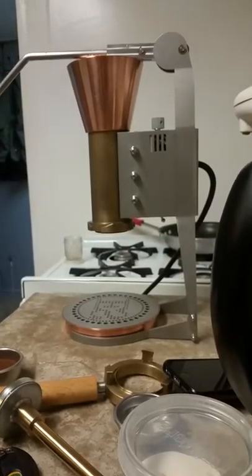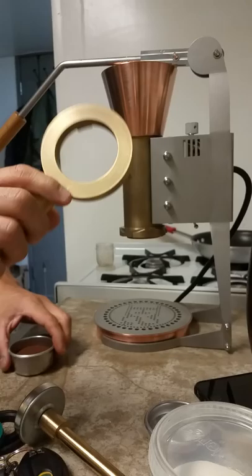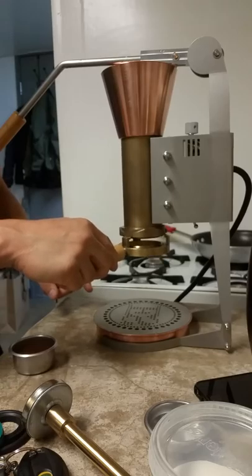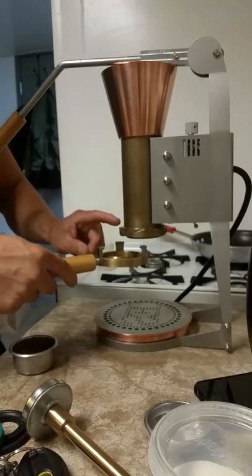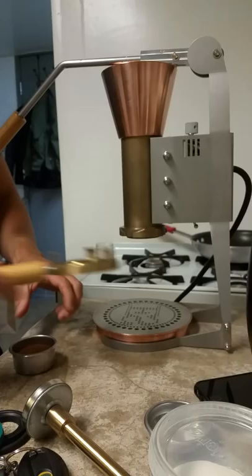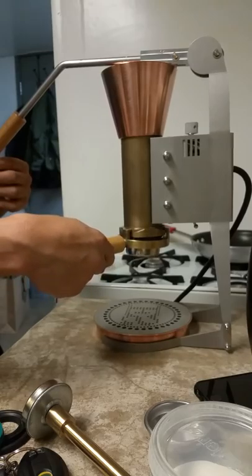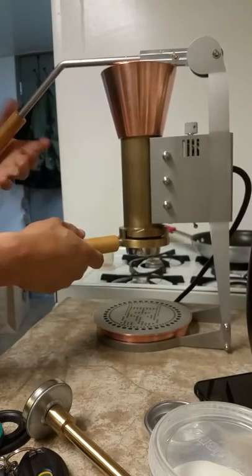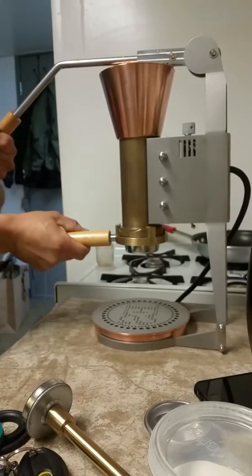So I'm going to go ahead and mount my phone here and apologize for the vertical video, but it seems to work best for this application. Here I have the portafilter. The portafilter has three hooks and it goes into this groove here. There's a tapered slope where the hooks slide upward and onto the top part of this ridge and that tightens the basket against the seal. The way you tighten it, since it's not wall-mounted, is you have to make sure the hooks are in and then you hold the handle here and you basically push like that.